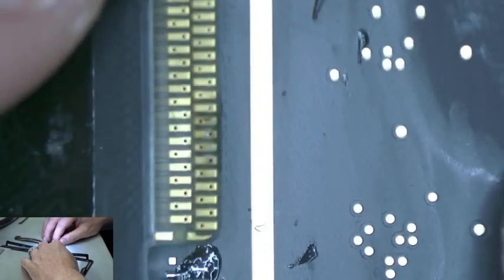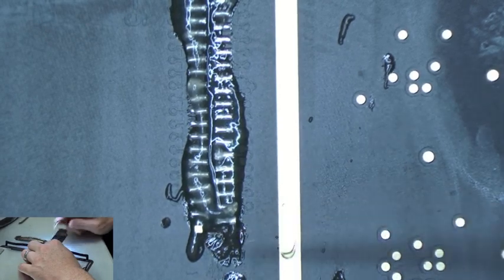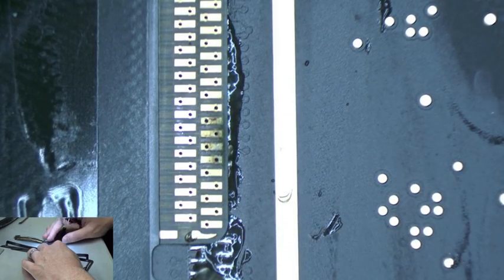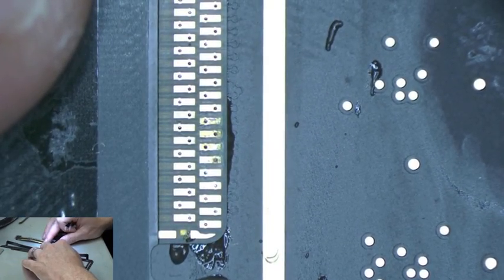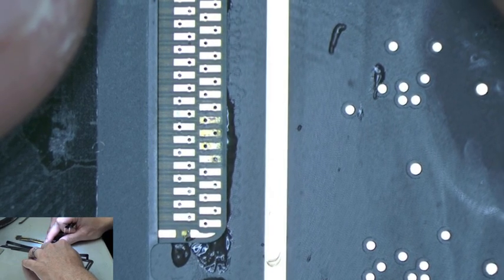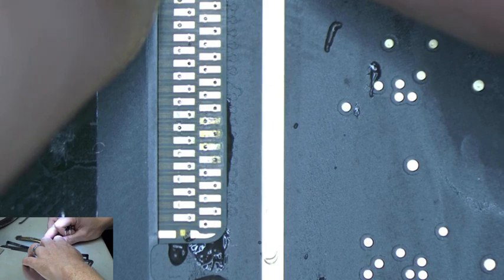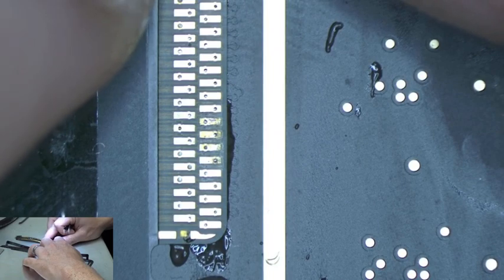And now we're going to lay this down. So you remember those square pads that I was telling you about? Those right there on each side of the connector. So as you'll notice on this new cable, there's this clear pad right here on the end. So what you're going to use that for is to line up the connector. You see how they show up through there? You can see it light up that clear pad basically. And once you get it lined up in the middle of that square, you know that your connector is lined up nice and straight.